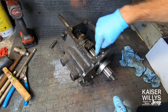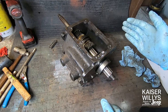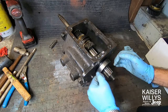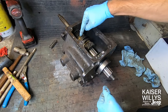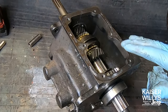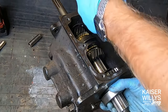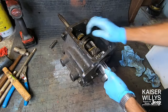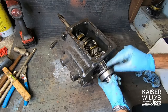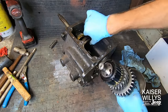For the next step, we're going to separate the main shaft — that's the back portion of this upper shaft — from the input shaft. This usually doesn't require tools. A lot of people have the problem where they take the transfer case off, this bearing pulls back, and you hear all the needle bearings that hold the main shaft pilot inside the input shaft fall down. In this instance it's okay because we're taking everything apart, but when you are just removing the transfer case and that happens, that's a problem. So I just grab the back shaft and give it a wiggle. Sometimes you've got to bump it, and this bearing retainer on the back will come loose and wiggle everything, and it will come right out.